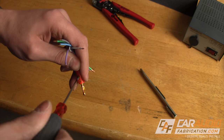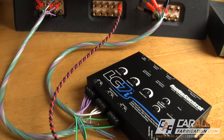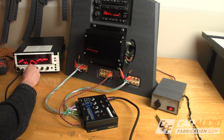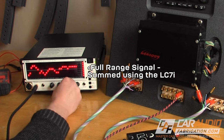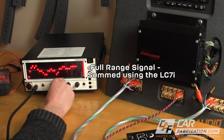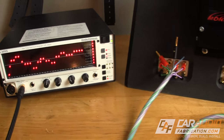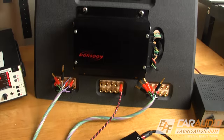If we were to tap into just one of these signals to add an aftermarket full range amplifier, we'd be missing information to send to our speakers — either lacking in bass, mids, or highs. What I can do is connect these stock amplifier outputs to a device like the AudioControl LC7i, which is used for signal summing. Now I not only have a low level RCA output to send to an aftermarket amplifier, I also have a fully summed signal that incorporates all the frequencies I can send to an aftermarket full range amplifier. Ideally, we would also want to incorporate an aftermarket equalizer to tune away the remaining peaks and valleys.